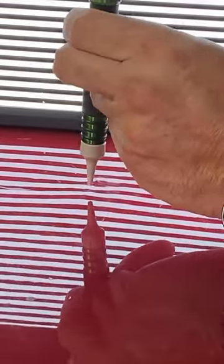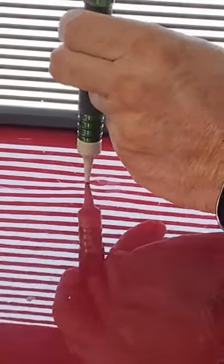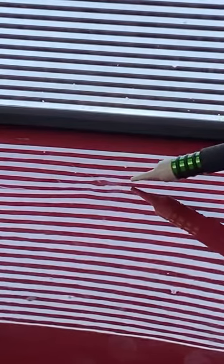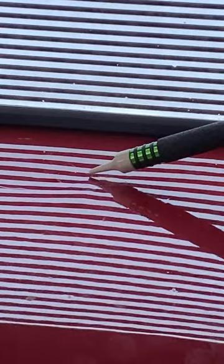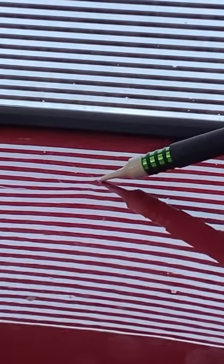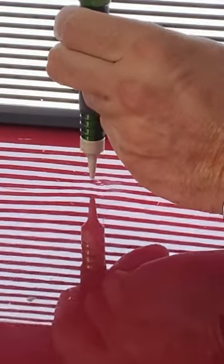You can't leave your outside low, I mean high. If you leave it too high, there's not enough metal flow to come towards the center, okay? If this is not looking like this, and this isn't looking like this, see how even it is, right? But you can see over here, it gets more tight, right? So I've got to tap here, this looks like it's almost gone. Really, it does. I might still take another shot at it, and maybe be able to raise it up flat.